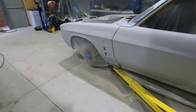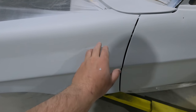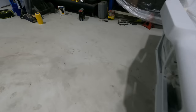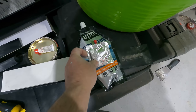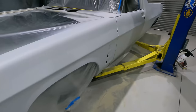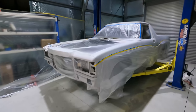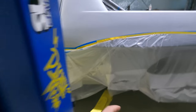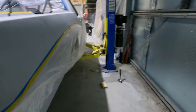This area here is a bit out of whack but it needs to be filled in because it's actually a low, so I didn't worry about it. I bought some dolphin glaze so I'm just going to fill in the minor stuff with that. I'm just masking up the factory body lines and in the middle here I just mask along the main line so you can just sand it so they both look identical.